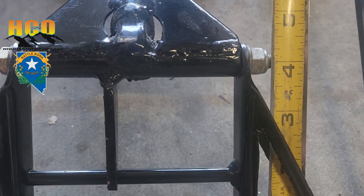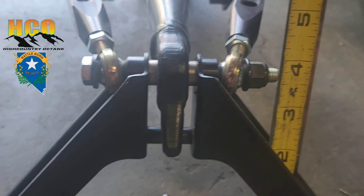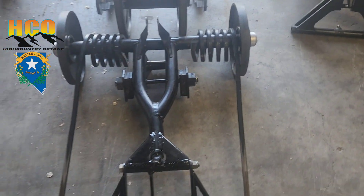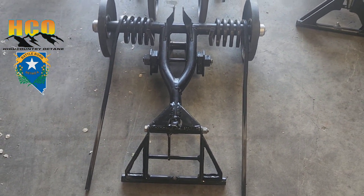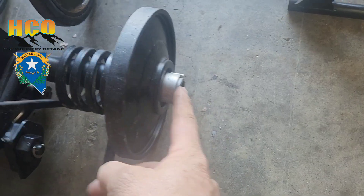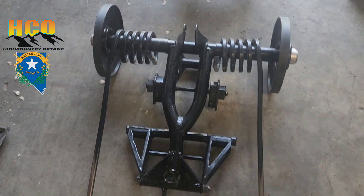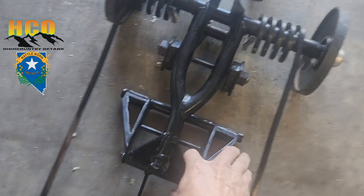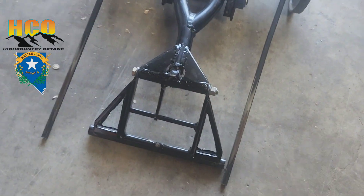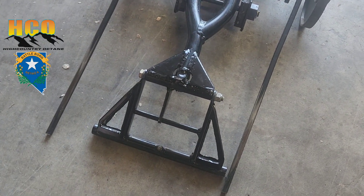As you can tell, we're basically four inches to the centerline of the bolt right there. When I move over to the stock Gen 4, we're at three and three-quarters. You might say a quarter inch isn't going to matter, but does that quarter inch — which raises it here — push your mounting points and geometry up in the skid enough to put a bind on something? I don't know, and I haven't been able to get answers. This setup has been done by a lot of folks and I don't know if they dealt with that measurement difference or just put it in and nobody noticed.